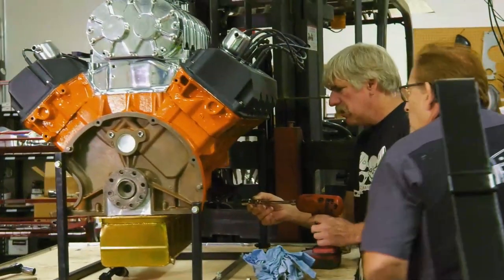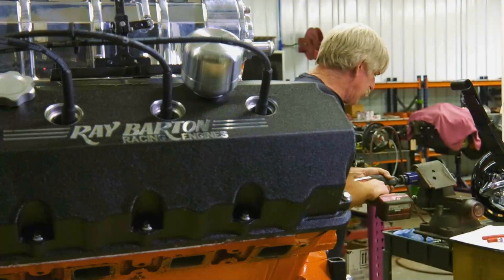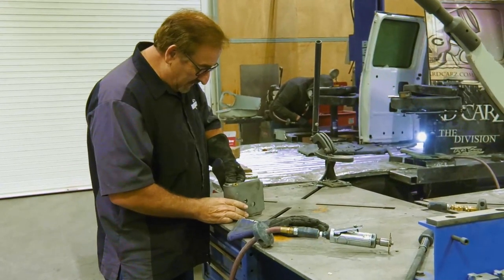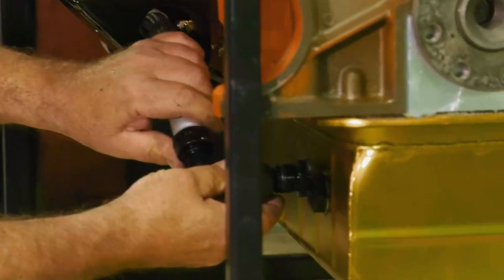This is getting to be crunch time. Doug and I are working on getting the engine mounts in position — I've already pre-mocked all this stuff up, so it's just a matter of putting it on the engine and getting it ready to go in the A100. Suspension, same thing — we've had it together once, had to blow it apart for chrome work. Transmission has to get married to the engine. The only thing that's easier about this one is there's no driveshaft. The output shaft of the transmission bolts directly to the rear end input yoke. So with all the things bolted on our drivetrain, there's only one thing left to do: install this bad boy.